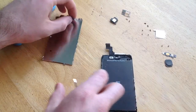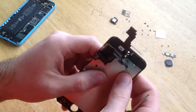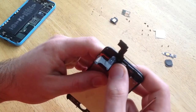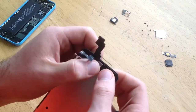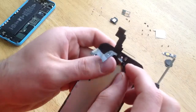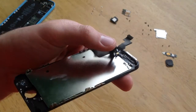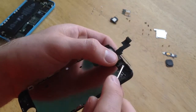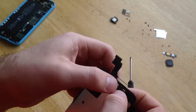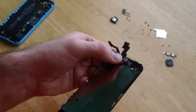Now you just start by reversing what you did — replacing and putting this metal plate back onto the new screen. It fits nice and easy in there in reverse order. There is a little hole for that piece — go ahead and stick that in there. This camera piece, stick it right there — there is a little hole for that. As you guys can see, there are two holes right there and two little slot-looking deals. Once you've got your camera in, there are holes in this piece and you go ahead and put those holes on the little pegs that stick up. Go ahead and line that up, get your camera in there, and line those holes up.